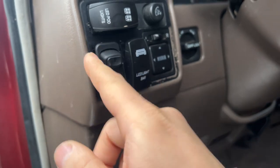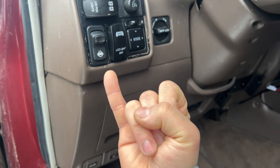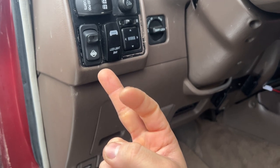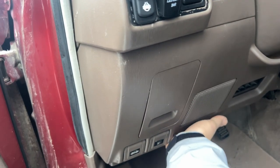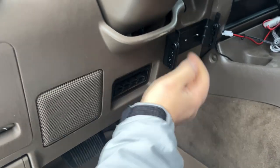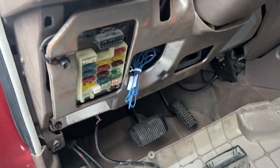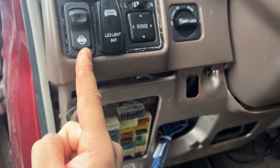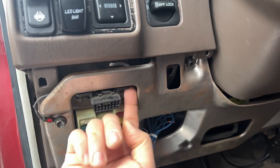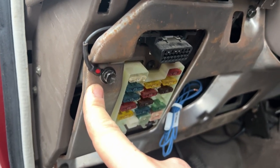The hole right here, you do have to trim a little bit more — it's not perfect, but it is what it is. As I said earlier, the switch has three wires: that yellow wire which we already talked about, and then two more — a ground wire and an ignition wire, that blue wire. I still have this unmounted because I'm still waiting for more parts to come in. I have the ground wire with the wire lights right behind here. I'm not sure if this is a good ground, but we'll find out once we get it rolling.